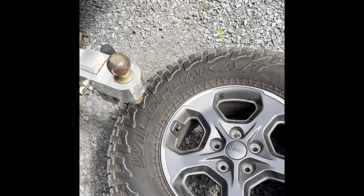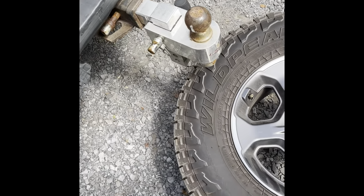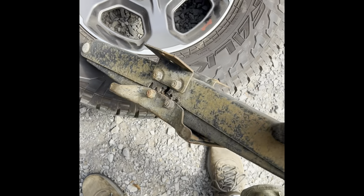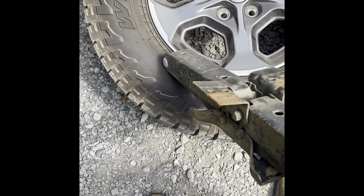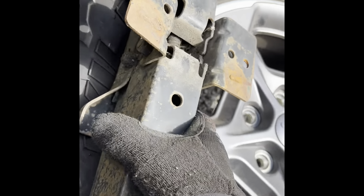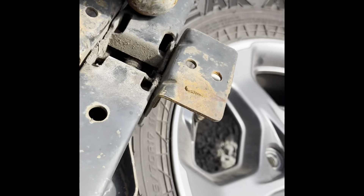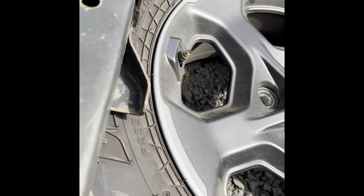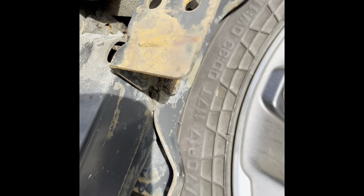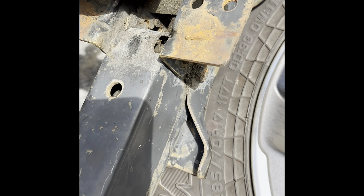So we're at the back of my truck. Now what I got is the tire with all the air out of it, and I have an old RV jack that I'm going to stick right under here. It works out pretty good because the edge of it forms right on the bead, and then I'll use my impact to break the bead.